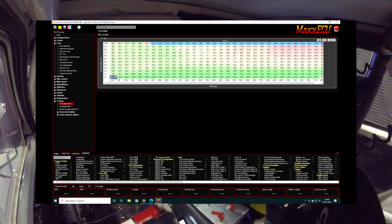With the sweep area selected, we right-click again, click Selection, and then Auto-Tune VE Table. You'll notice in the background that mtune has highlighted our swept area that we've auto-tuned. Those cells are now blue for tuned.